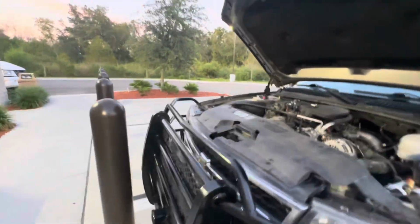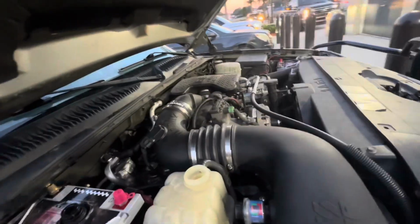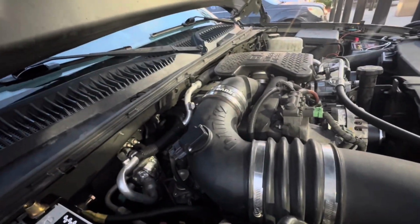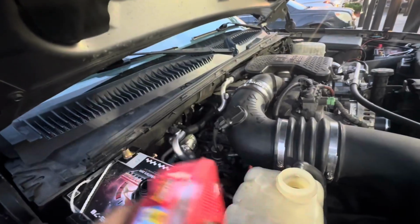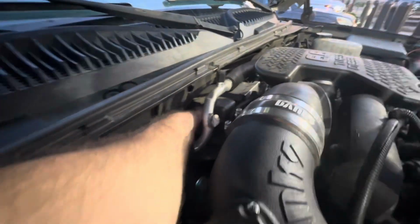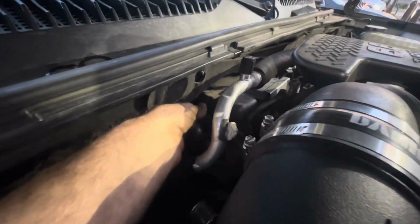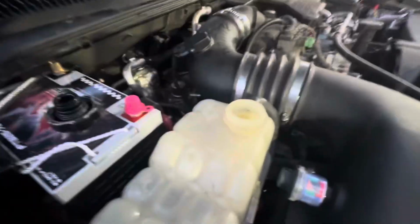Anyway, the thing does not attach very well. You can feel it click on, and it does have some positive engagement, but well, it comes off under pressure. So since I have limited resources, I went inside the store and I got some tape. What I'm going to do is tape this hose to the other hose in an effort to keep them together so one of them can't slide off and pop off of there. And I'm gonna refill my coolant back up again with some jugs of water that I got also inside.